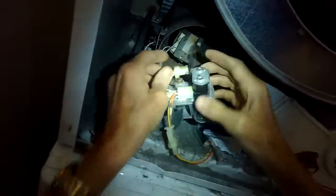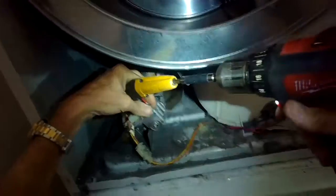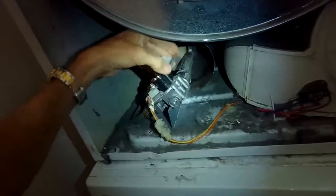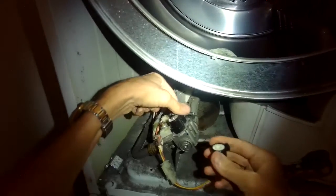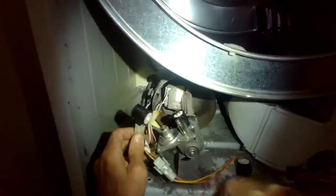While I'm in there, I'm going to go ahead and replace these primary and secondary gas coils because they're really cheap and easy to replace — I just have to pull a couple of Phillips head screws. They're basically electric solenoids that use a magnetic field to pull up on a pin, allowing gas to flow into the combustion chamber. If they get weak, the flame doesn't stay on long enough and you don't get very good results. Here's the part number for the primary and secondary gas coils — I think it's only about 20 bucks. There's a skinny one with terminals at the top and a fatter one with terminals at the bottom. I separate the old gas coil from its electrical connector by wiggling and pulling.